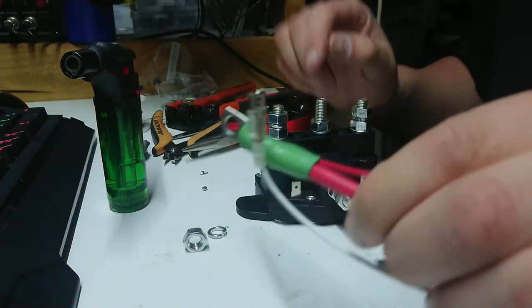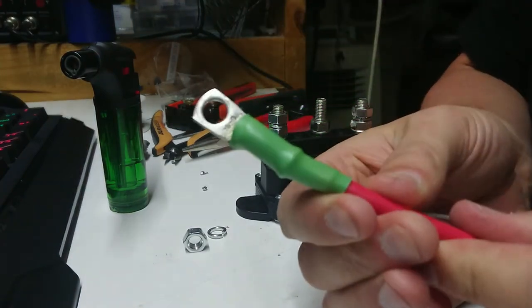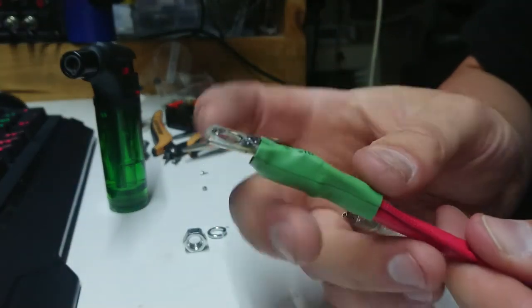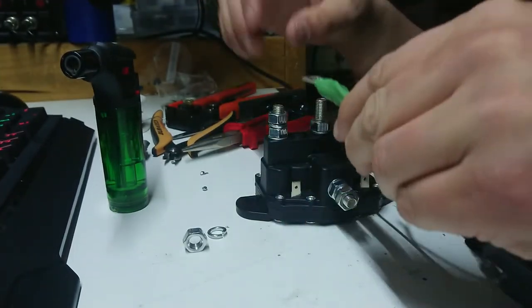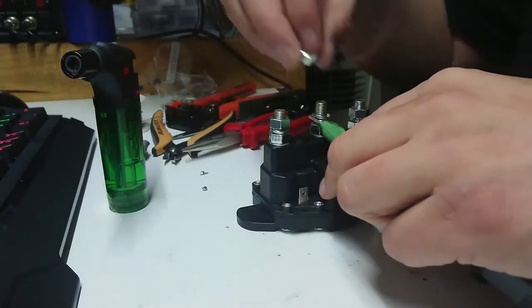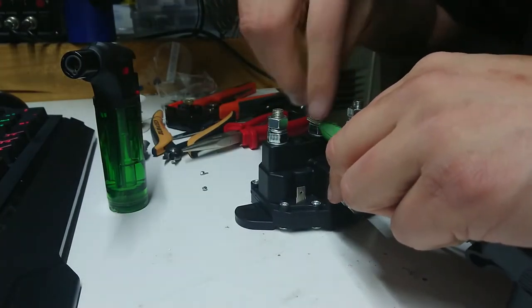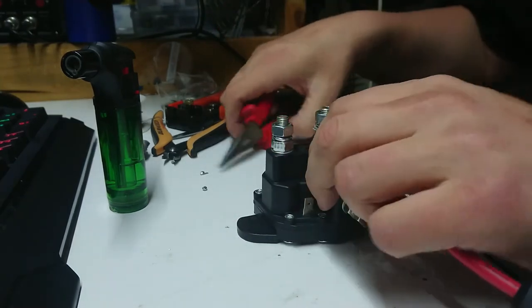Alright, so I needed three hands for this bit, which is why we did it off camera, but I have my extra terminal soldered in the top there, although it doesn't look real pretty. I can assure you it's on nice and firmly. Now that can go on the top, and we've secured a positive connection and power supply for both the solenoid and the remote control receiver.